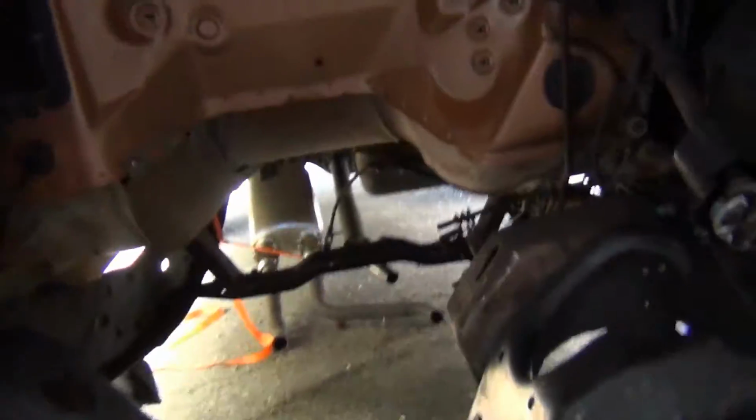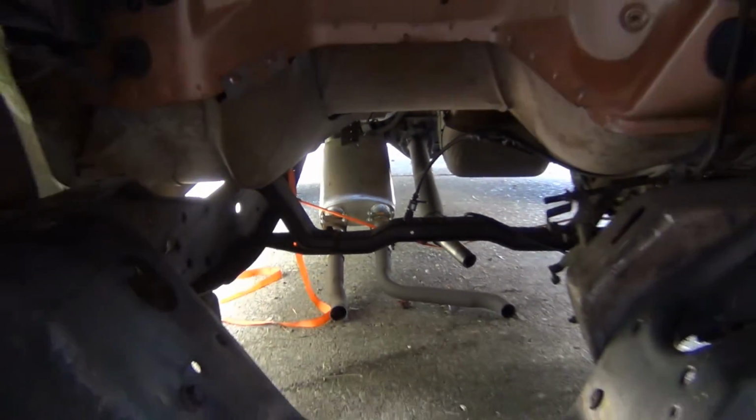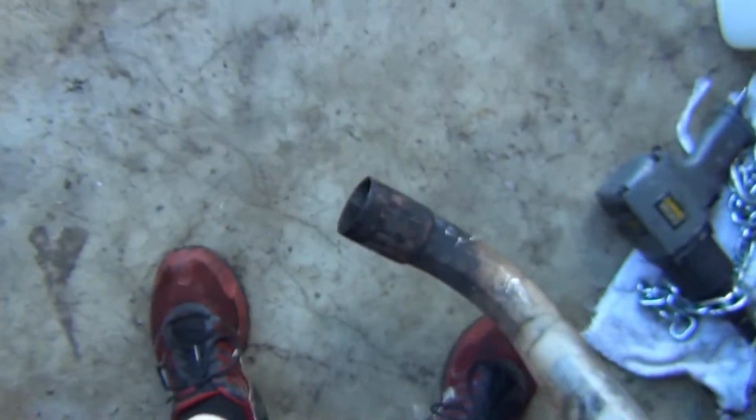And then the muffler that I just bought, this Jones exhaust muffler, which is a really good muffler. I bought it with a 3" in and dual 2.5 out. Right now it's set up for dual 2.5 in and 3 out. Now what I'm going to do is switch the muffler around, have the one 3" welded up, and then this, since that's already 3".